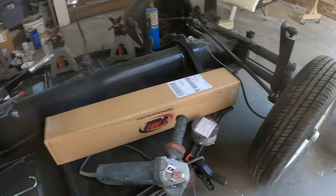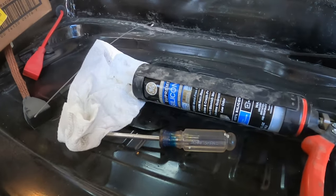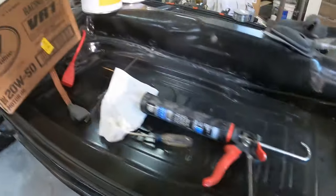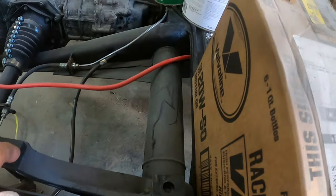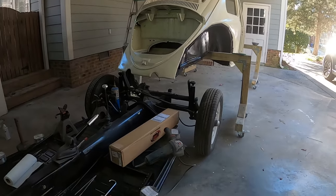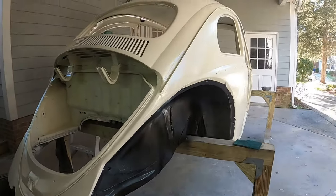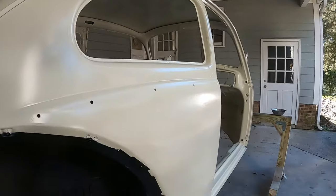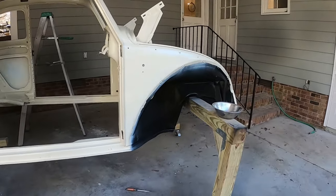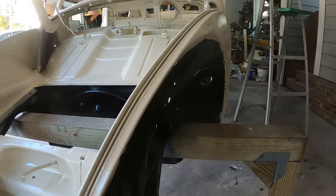Along here and on the roof and in the engine compartment - everywhere has clear coat. You can see all this junk I have sitting on the chassis because I put the caulk which is see-through silicone. I have all these pads ready for me to lower the body onto. Right now I'm just waiting for the silicone to dry and for this clear coat to dry. The clear coat got a little drippy so I'll very likely do a wet sand on this in a couple of days or a week, when the clear coat fully dries - I just want to make sure everything is protected.